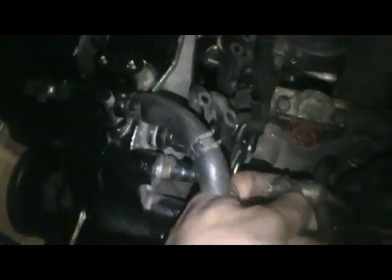I had to run out for a minute but I'm back now with some hose. I got a bit of fuel injection fuel line, some extra heater hose and some vacuum line. I'm going to be redoing the fuel lines first — you can see I just cut it, I've been trying to get that little clamp off, it goes right there with these two pieces of hose. I got about a foot of hose and that's pretty much all I needed. I got the new fuel lines all on there, two pieces. Now I'm going to start putting on the oil lines for the oil cooler — there's the one, I'll clean this one out after.